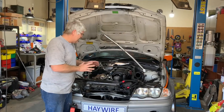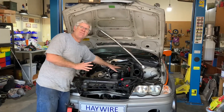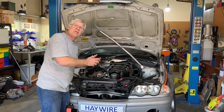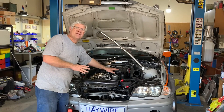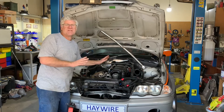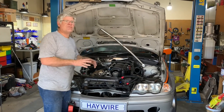The plastic cooling pipe connected into the back of the timing cover is a pain to get out. We could manage it without removing the intake manifold because we have the M50 manifold — there's a lot of space underneath to get arms and hands in. If you have the standard M54 intake manifold, you are going to need to remove it.